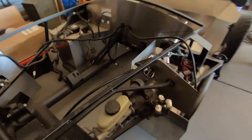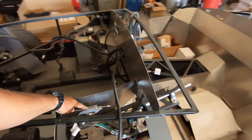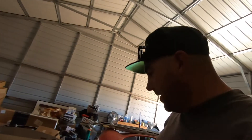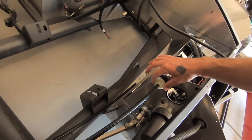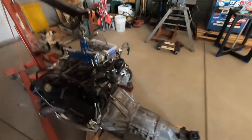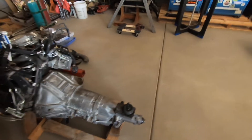I also got a new clutch cable and quadrant. They recommended that with the Ford Performance clutch you install a new clutch cable and quadrant, because the old plastic quadrant can break under the extra pressure from the new clutch. I also put in a new clutch fork. This new quadrant is adjustable down at the clutch fork end rather than at the firewall.